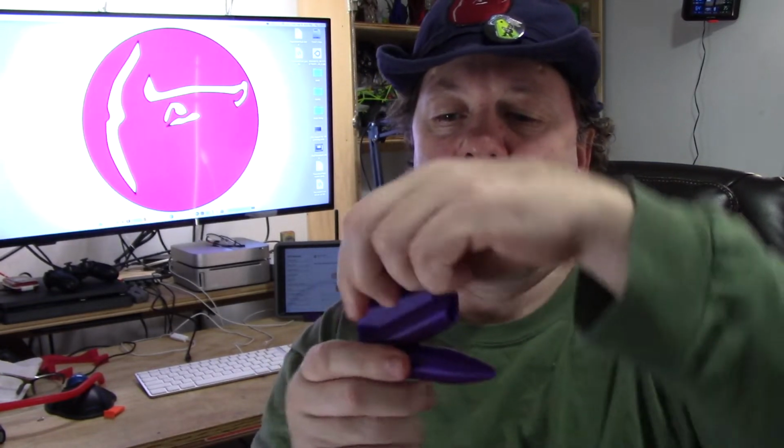Now, there are other ones, and this one's a really popular one, but it's kind of a pain in the butt. You basically slide the wires in. You have two parts. This goes into your corrugated split loom. Slides in. Wires go in. You slide them in the slot here. Slide this in. Once again, they slide in the slot. You spin it. That holds them there. And then you just kind of slide it along the split loom, and it loads it. It's kind of complicated. It's kind of a pain in the butt.